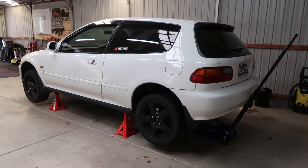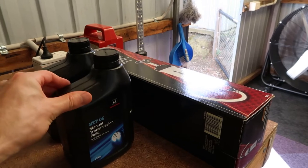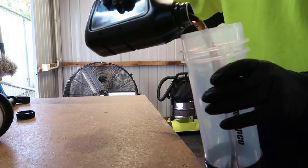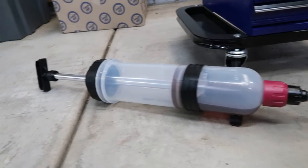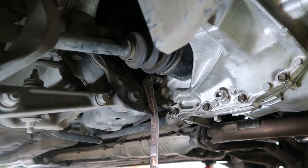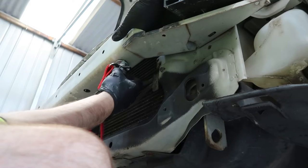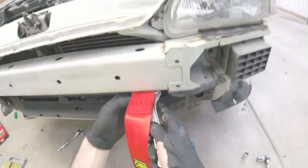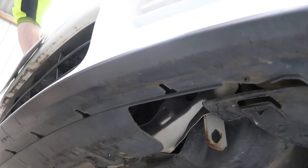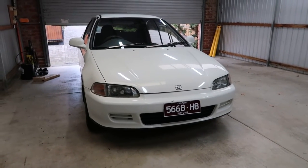In the last track day, I didn't require a tow strap, but for every other track that I'd like to do, I need to install one. It turns out that the fuel filter is pretty new, so I'll just replace the gearbox oil while I'm here. To help me top up fluid, I went out and purchased this massive oil syringe for $60, which unlike the brake bleeder tool, is the best $60 I've ever spent on tools. This $40 tow strap is the real deal, and not just some Alibaba crap, so with a quick visit to the bolt shop, I've got myself an easy installation. Installing a tow strap to a road car is a bit cringe, so I made sure I can hide it in the bumper, but still allowing me to access it when I need it.